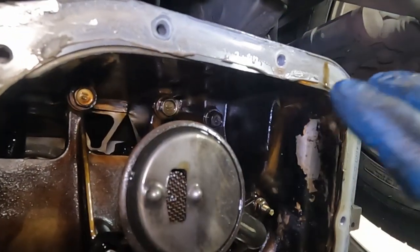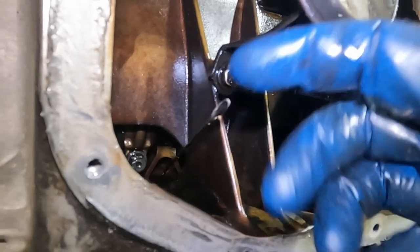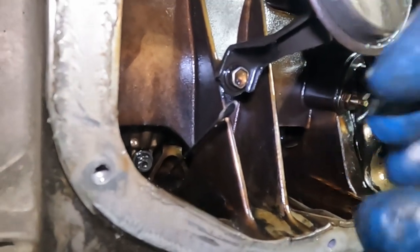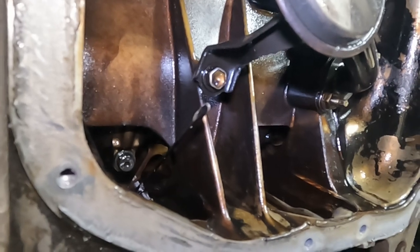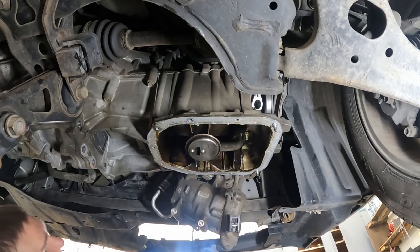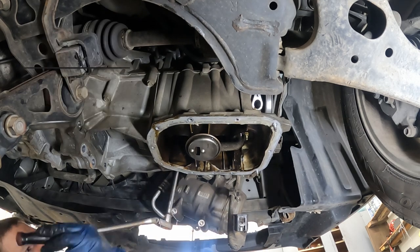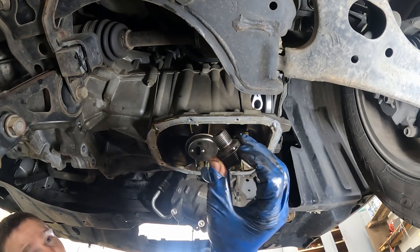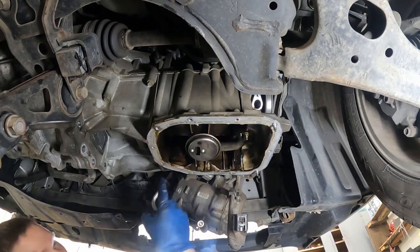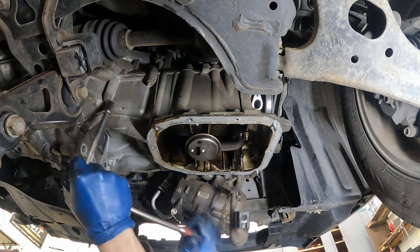Underneath this pan are three bolts we have to get off. From here everything looks like a 12 millimeter — just our perimeter bolts. There is the dipstick right here poking through, so we'll see how easy that is to come off. We may have to pull that tube out from the top, but getting it off may not be necessary. Oh — I forgot, underneath the oil filter we've got to get that bolt out. That is a 12 millimeter allen. There's a bolt underneath — okay, just loosening them all.